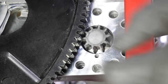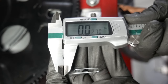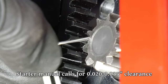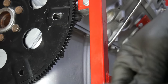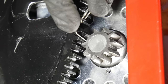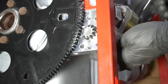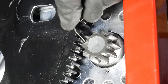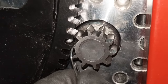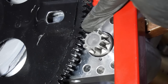Once it's been torqued back down, we will once again energize the starter solenoid, and this time we do have a gap to measure. Our high-end calibrated tool is this paper clip, which does not fit between the gear teeth and tells us that we're going to need more space. The single shim that came in the kit just wasn't enough, so I had to find some others I had sitting around. We'll stack two shims together to make a thicker spacer, but the pinion still needs a bit more room. So we'll try a stack of three shims with a sixteenth-of-an-inch overall thickness — and finally, we have the fit we were looking for. The paperclip does slide in between the teeth of the ring gear and the valleys of the pinion.